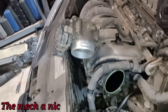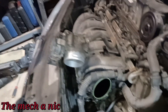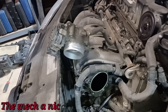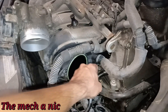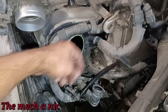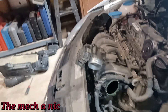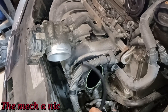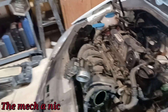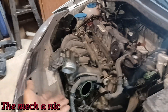It's not that great of a sensor, but I put my vacuum pump on it. I've got my big vacuum pump right here and with it connected to my scanner, with the sensor unplugged it goes to almost 18 psi - 17.5 psi something like that. Once you plug it in it goes to around 13.5, close to 14 psi with it just plugged in, key on engine off. Once I start pulling vacuum on the MAP sensor I can get it down to like 3 or 4 psi and it seems to be holding. The numbers aren't jumping around. If I move the harness it doesn't fluctuate - it seems rock solid. At this point I don't think it's the sensor. It's been replaced and even though it's not a good quality part, it seems to be working.